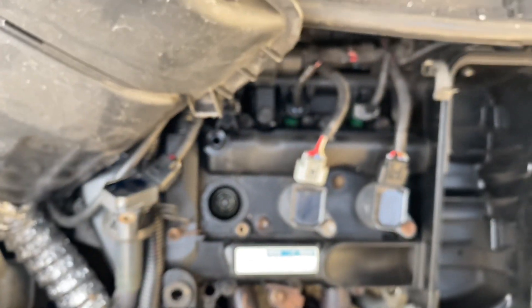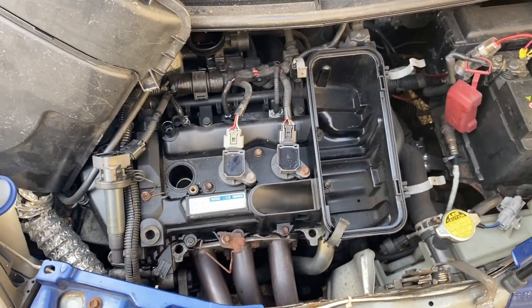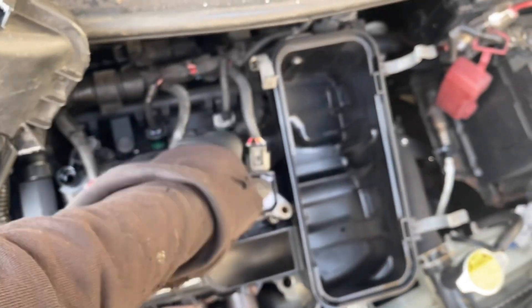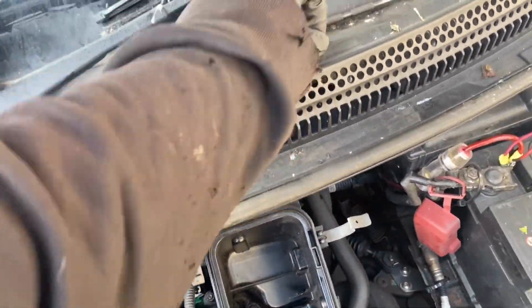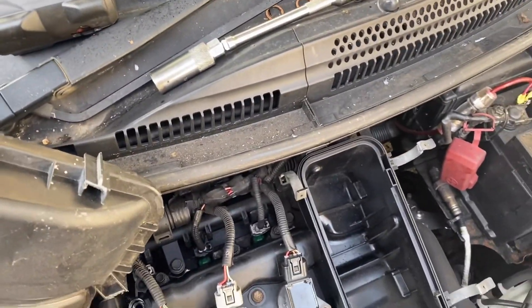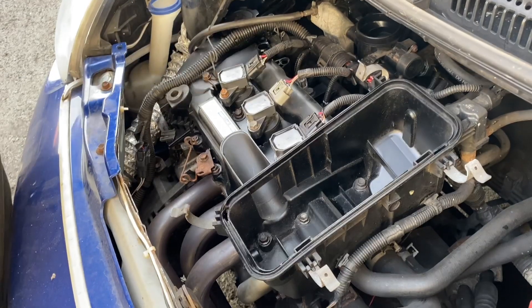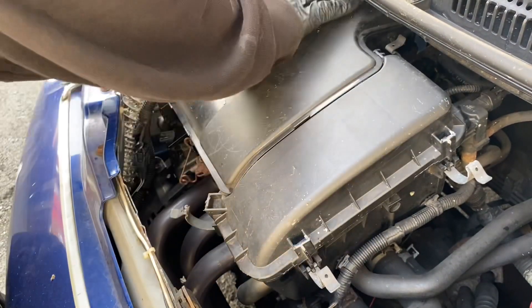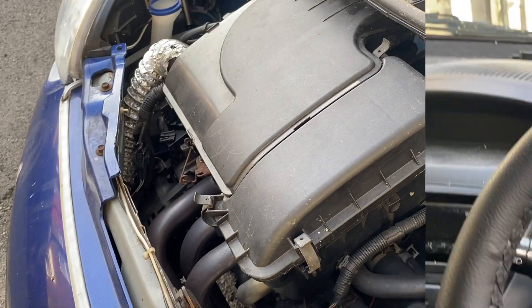Yes - now as we can see the marks are pointing towards the inlets. I'm going to do the same thing for the other two plugs off camera. That's two and that is three. The middle one I did have to use a standard type washer; the other two I had to use the extra compressible ones - they give you a lot more room to play with. Let's put all this back together.